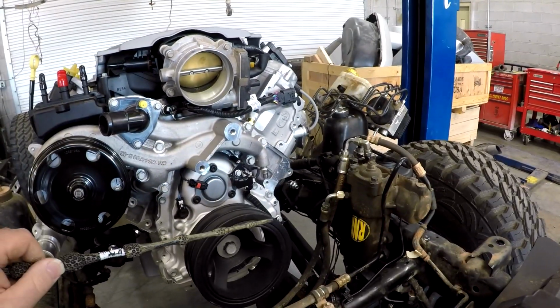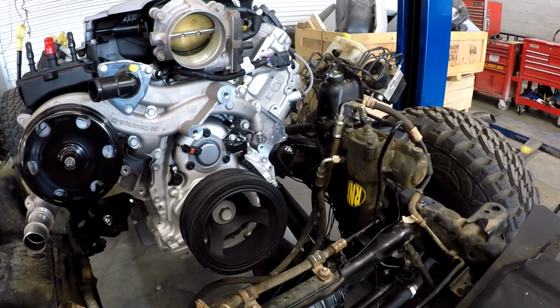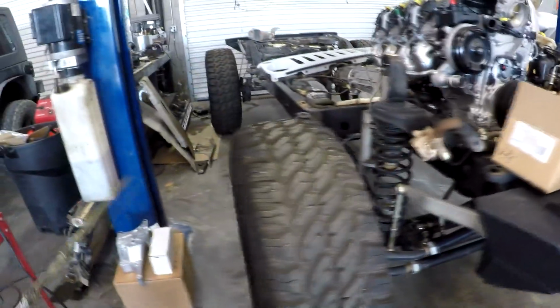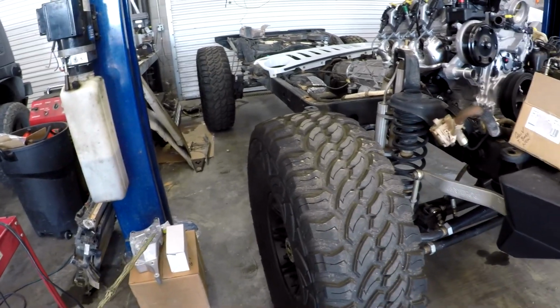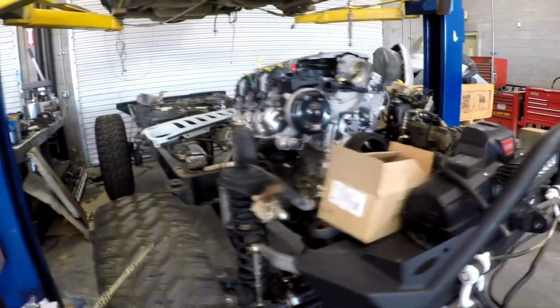Redneck Ram is a good alternative to the more costly power steering systems. So with a Redneck Ram, you're basically running a stock pump, stock reservoir, all that. And it's marginal with heavy 40s, especially in a parking lot when you're cranking on the wheel. Obviously, it's working for this guy. But if you're going to be running 40s, you're probably going to want to step up.